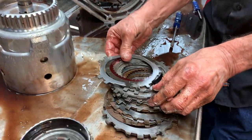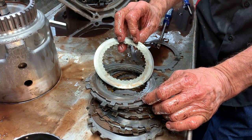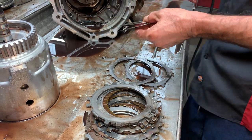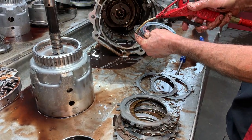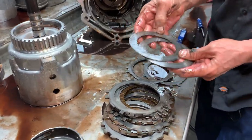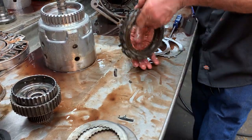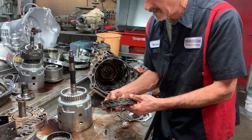Here we go - here's another sign of water. Now if you look at this clutch right here - no lining, it just fell off. Come over here, look at this clutch here - no lining, it fell off. I'm shocked that one hasn't fallen off too on that side. But that's what happens when water gets in these units - depending on how much water and how long a period of time, the clutch plates will finally just fall off the steel. That's a big problem with water. You can flush it, flush it, flush it - it doesn't matter, you can never get all the water out of it.